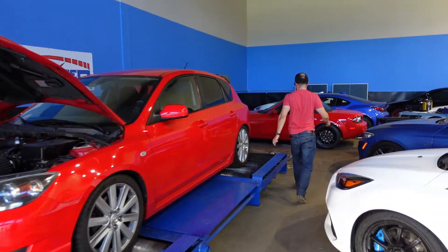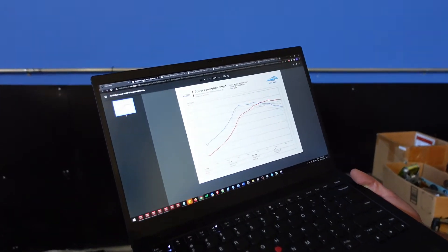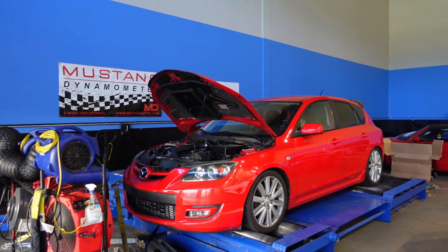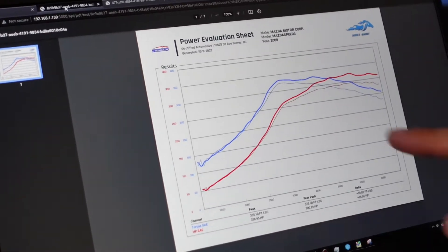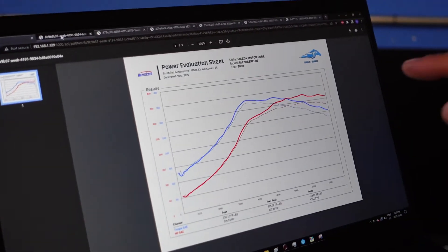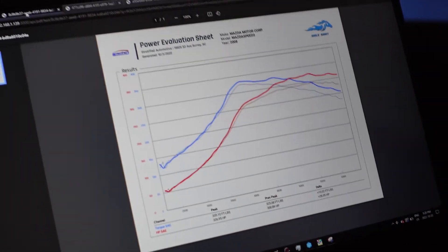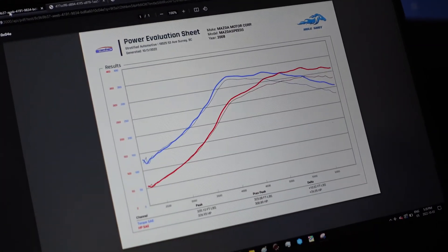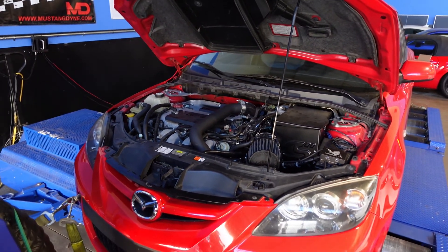Let's have a quick look at what those graphs look like. This is the pump gas tune. On our Mustang dyno, this car originally made just shy of 300 to the wheels, and now with the catback he picked up 25 horsepower. You can see it also spools up faster and carries power deeper into the power band. Basically with just the addition of the catback — which required wastegate table changes since the turbo responds differently — he made as much power as he did by adding ethanol.